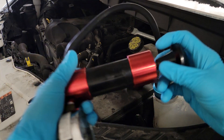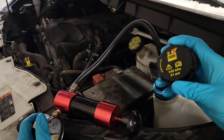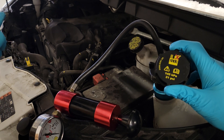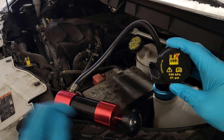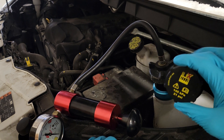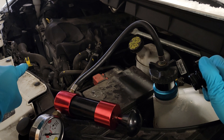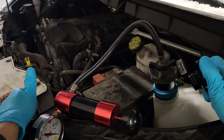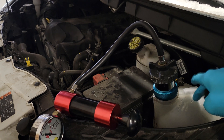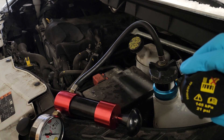One of the things I want to start off by saying: if you guys have the vehicle already hot and you do not have a cooling leak — I'm not saying take a radiator cap off like old school. I've removed the degas bottle cap from a vehicle that's already hot slowly and successfully many times. That's not the same with the radiator — if you have a cap on the radiator, that coolant is going to juice out when it's hot. There is a bigger air void in the degas bottle that allows the level to change without blowing the cap off in your face.